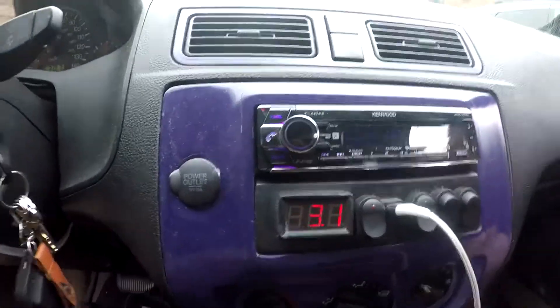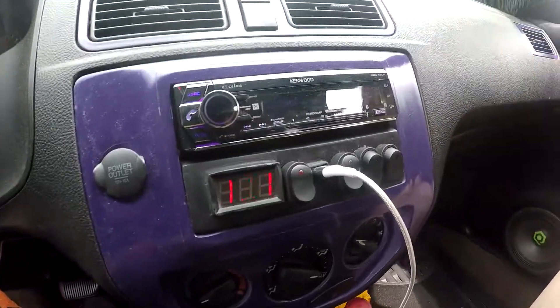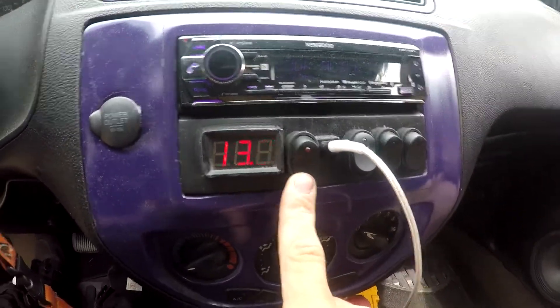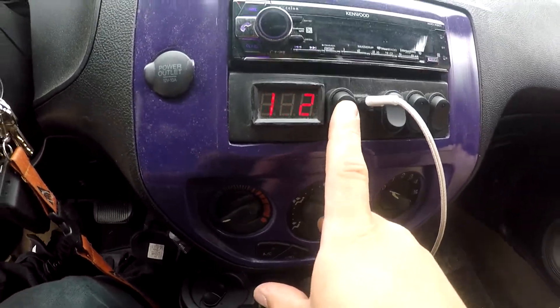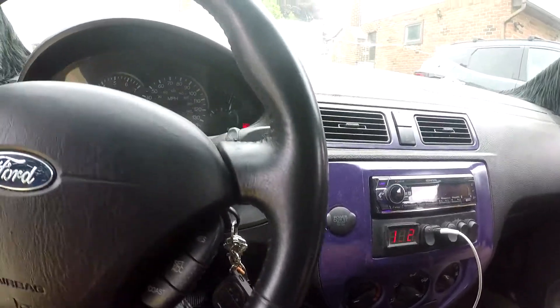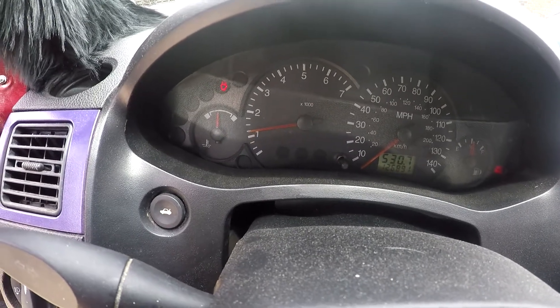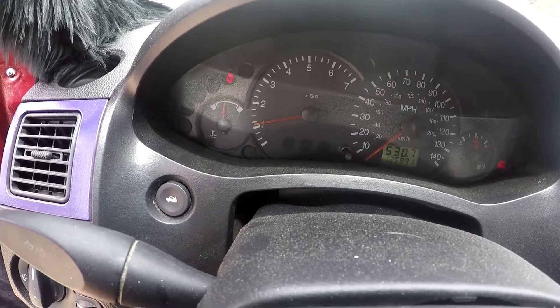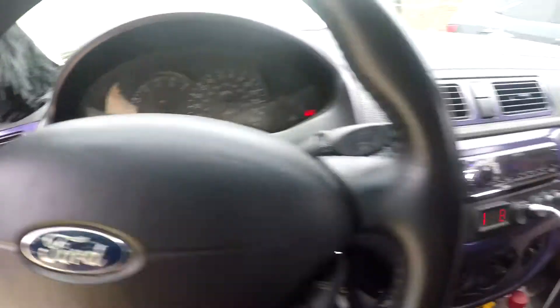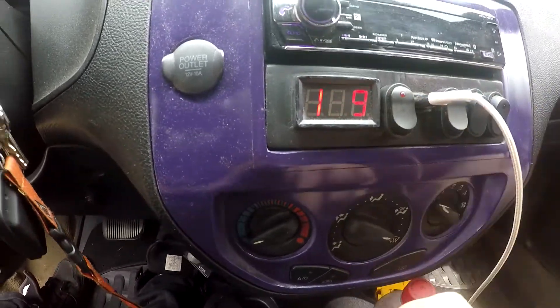Now that that's not happening, my voltage still drops when I lower my RPM. As you can see right here, my voltage is sitting at 13.1 volts. I have my amplifiers turned on and the voltmeter on — no music is playing, but the radio is on. This is my switch for the amps; once I turn that off it goes back up one volt. When the car is on a cold start with RPM up higher, this doesn't happen. To demo the vehicle I have to put my foot on the gas and get my RPM up to about 1100, maybe 1200, and then my voltage hits 13.8.